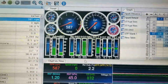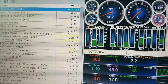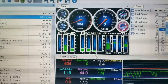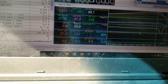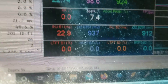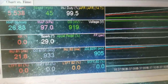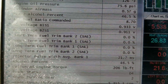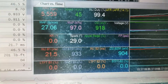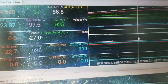The last thing I want to see is how much injector we need. I hope I can get away with just the stock E85 truck injectors. At 50% alcohol content, that's probably about all we can do with these — but that's fine, we can put in bigger injectors and tune for that. From that first-gear pull, I can see 29 degrees of timing from the added ethanol content with no spark knock at all — great sign. The injectors look okay for this truck at 50% alcohol; we're under the 100% injector duty cycle threshold, so we're good. We'll still upgrade them, but you could get away with stock injectors on a stock truck like this.